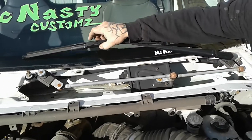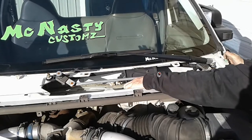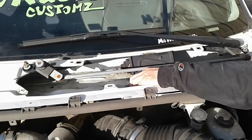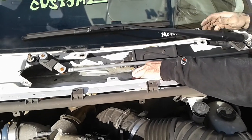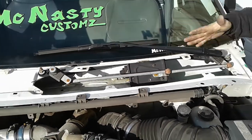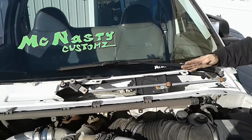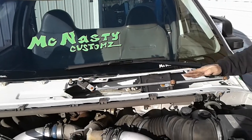That's where your wiper is at the lower level. If you play with it a little bit you'll see it yourself — this really doesn't do a lot, but if you want perfection on each piece you might want to adjust it. It's spring loaded so it won't make a huge difference. That's basically your install — you plug it in, the wipers will come on and stop. I can't stress enough that you want your linkage straight across.